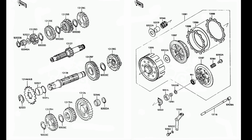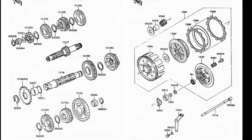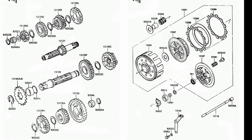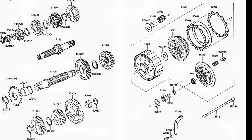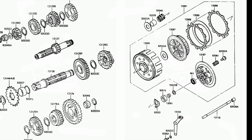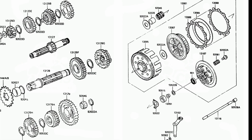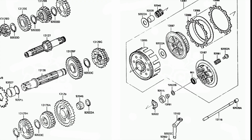In addition to the new gear sets, a redesigned clutch was added that looked to upgrade the 86's lackluster action. In order to accomplish that, Kawasaki swapped the steel drive plates of 86 for lighter aluminum units and reduced the thickness of the friction plates slightly. This was done to both lighten the clutch and help make the motor feel more responsive. To help fight the fading issues of 1986, the new clutch also added an additional spring, raising the total found in the clutch to 6.